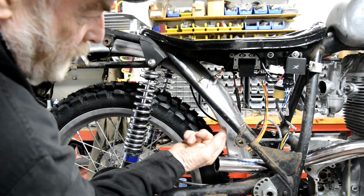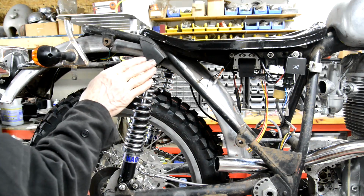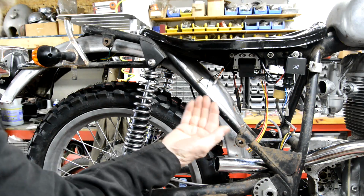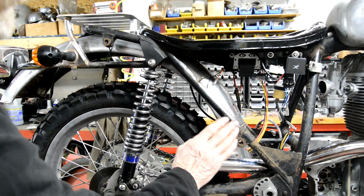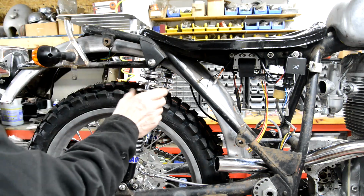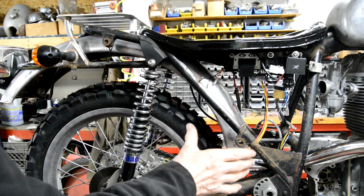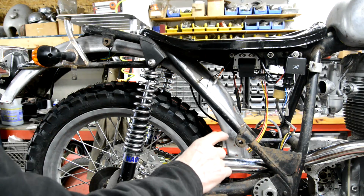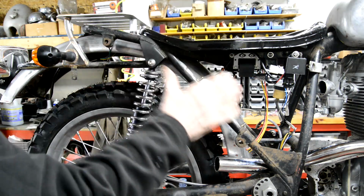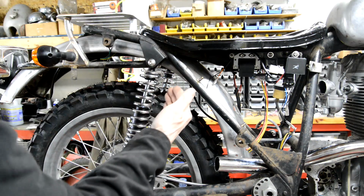Okay, so to come back to my problem, if I'm only going to make it about an inch out of here, this sticks out an inch more than that. So although I'd have an inch of depth here, there it would be flat against it. So my first thought was to make it to here and then curve it out round that. And partly I got thinking about the fact that the one that sticks out a long way with a pillion passenger has a heat shield on it. So I was thinking I maybe wouldn't need the heat shield if it's right close in and it's not going to have a pillion rider. But at this back end, there's a chance you might reach over all sorts of things. So I thought it would be nice if it went inside.